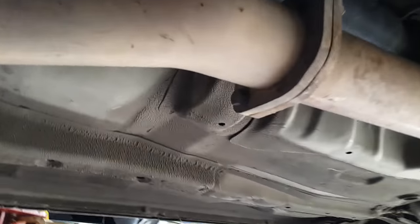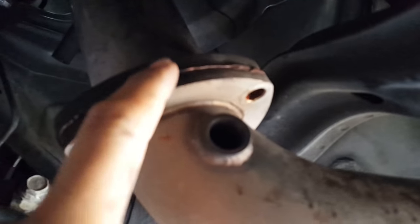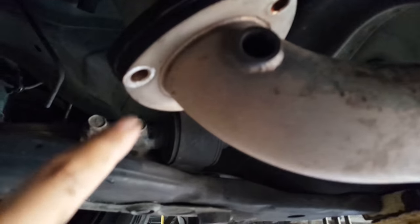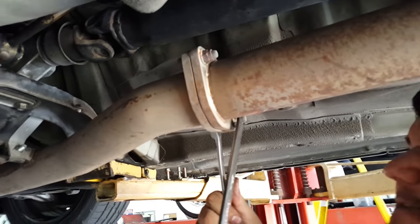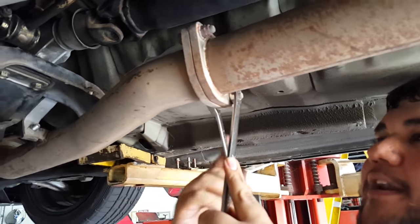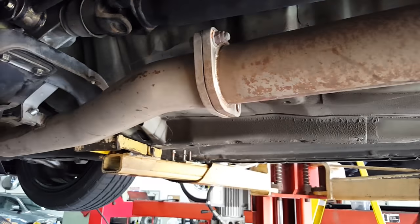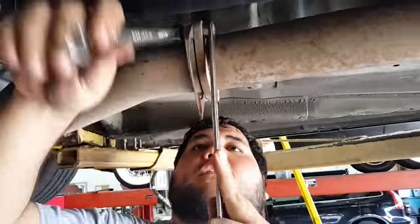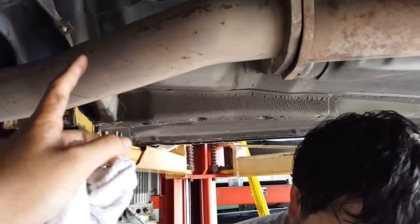Alright, next we'll take off this back one. Now if you weren't sure why I needed gaskets — it's because we didn't have one when we originally put this back together, so I just used gasket silicone, which wasn't the best idea, but it got it running. It was the copper stuff, which is meant to be used, but I don't think it was meant for track use — probably more for generic exhausts, and also meant for a brand new, flat exhaust surface. See, that's how we kept this one on — otherwise it would have come smacking one of us in the face.